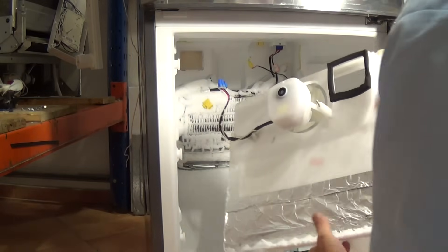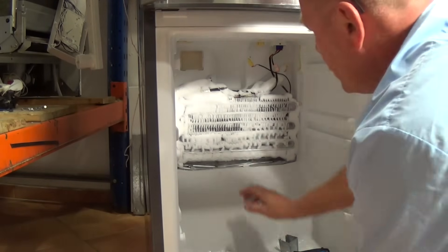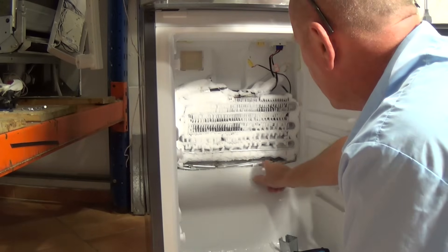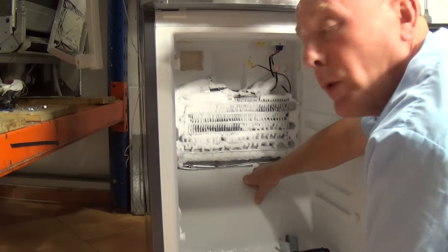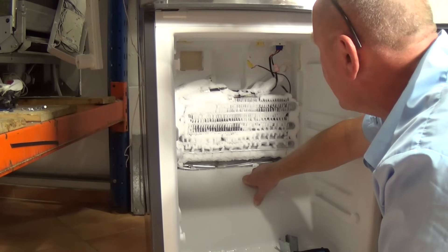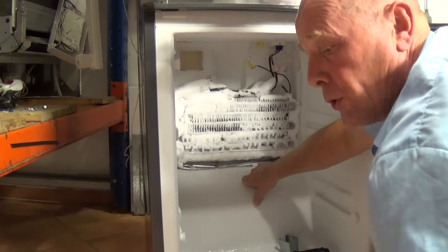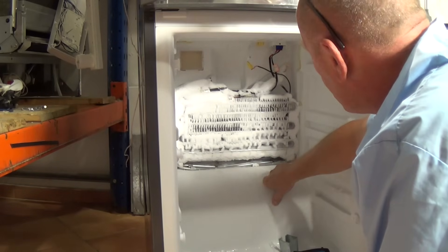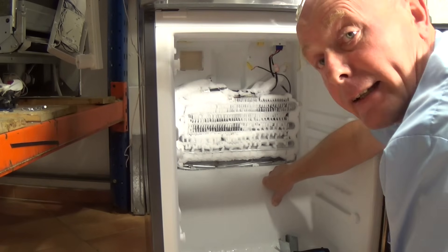Right, that's our fan unit — there's our fan motor. But you can see what's going on here: we have a large amount of ice which has built up onto the plate. You can see the element at the bottom running along here. We're not going to test this at the moment — we're going to let it defrost for the next five or six hours, or in these room temperatures I'm hoping it will defrost within the next hour or so. Then we'll be able to check the components, check the fan motor, the sensor for the defrost system, and the element.